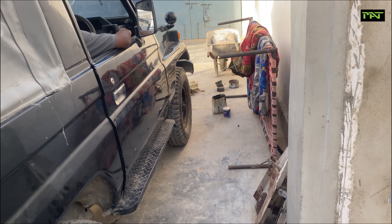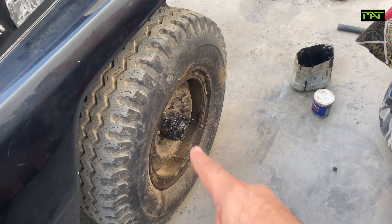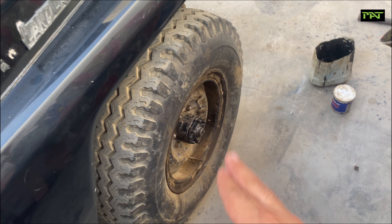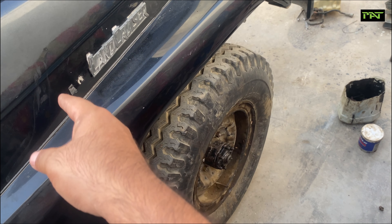Along with this, we had another thing — in this RTR, there were front wheel hub locks, because it is not by default from the manufacturer. The wheels are connected to the differential, and in standard configuration, if you have not engaged 4x4, then you carry dead weight on your front wheels. Generally, we use hub locks. We also provided them to this client.